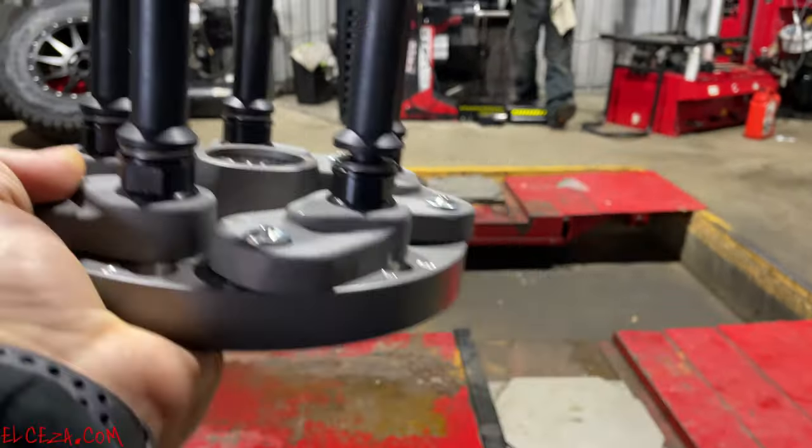What happened more than likely was you didn't have the butterfly cranked down, you weren't running road force, you didn't have the butterfly quite tight enough, and the assembly on that spindle is rotating at 300 RPM, and the DC drive sends a signal to the spindle to stop, and it stops. Well, what happens with centrifugal force? The rim keeps moving. So where it wanted the weight was here, but it slipped on the spindle, so now it's here, that far away from where it actually wanted the weight. And that will cause it to chase weight.